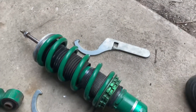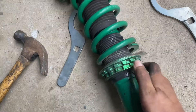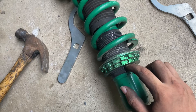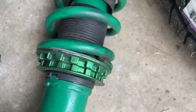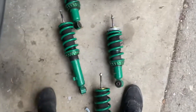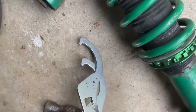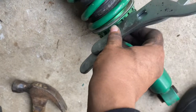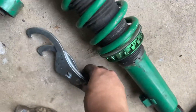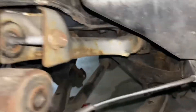Let's lower her a little more. One side is done. Now I'm doing the last side. For the rears, I just max them out — this bottom collar has to go all the way down to the threads, just like this one. You can't go any lower. All coilovers are adjusted. The rears are maxed out, as low as they can go. Front I lowered about two or three wrenches — I just measured it like that. I'm happy with that. Upper arm is on there, not fully bolted but it's in.